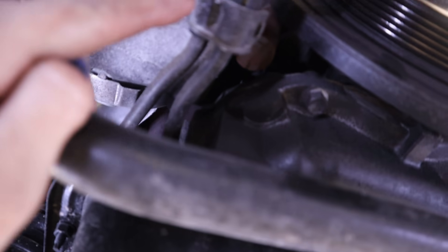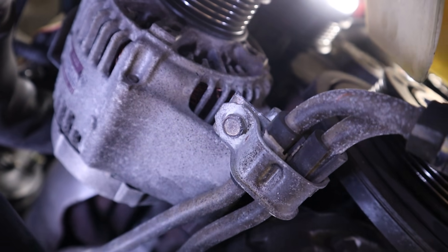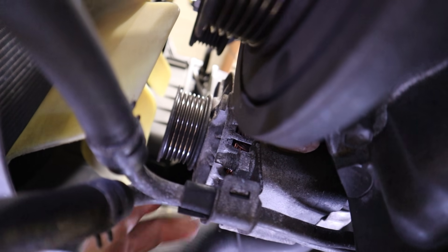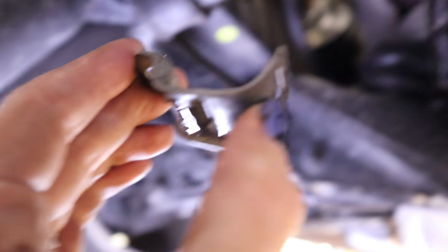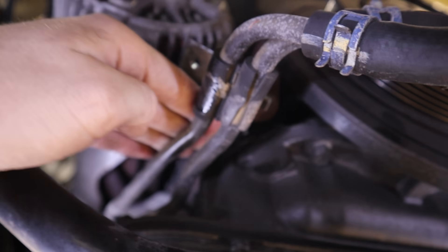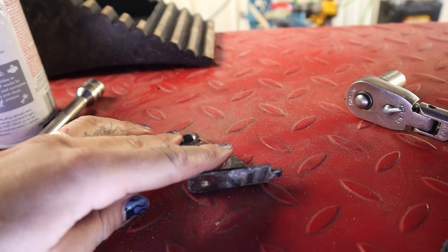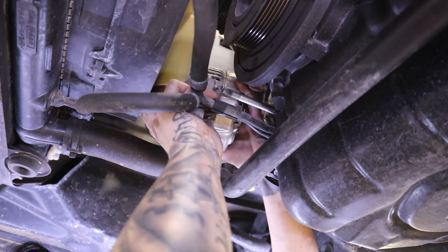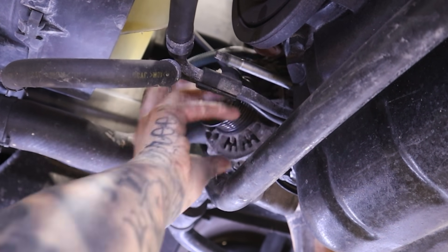What we've got going on right here — these transmission cooler lines are also bolted to the alternator at the bottom with 10 millimeter bolts, and then on the other side we've got a 14 millimeter nut. So this outer half comes off — now these lines are free. I'm going to grab that 14 millimeter nut up there, set those aside, and then this should slide off. And then it's like a little game wiggling this guy out of here.